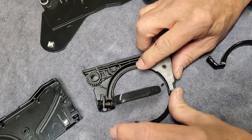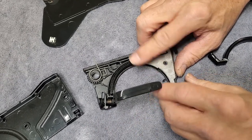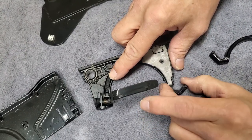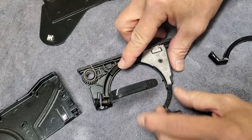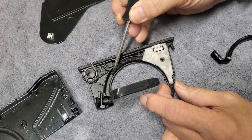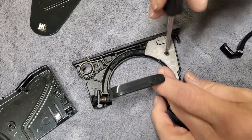Slides, but I'm kind of thinking I might want to sand it on the back side here a bit. But it could also just be because I don't have everything together. But you see, with 3D printing, you don't get total smooth. So I think I'm going to sand the back of this a bit with some 350 grit sandpaper.